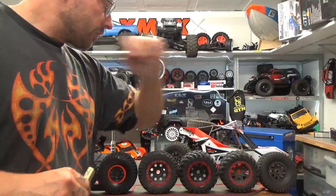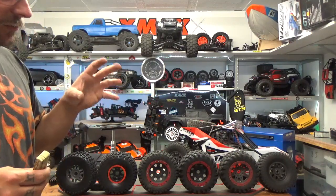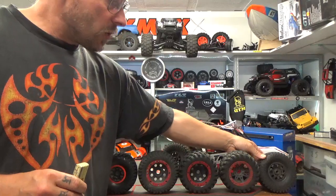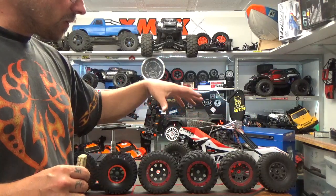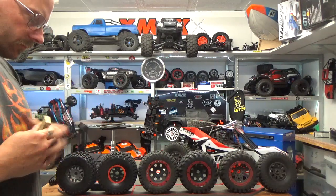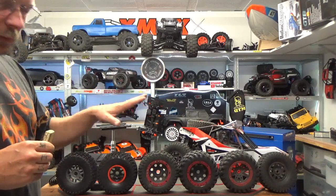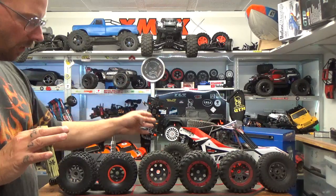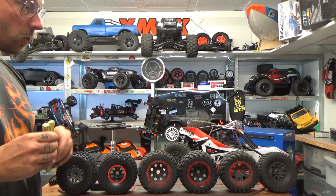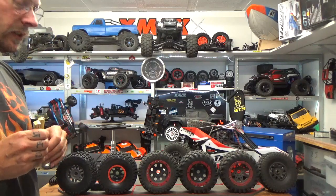The Team Magic Desert Buggy tires are also a little bit soft, but not as much as the DB8 tires. I really love them — it's really fun to drive. I don't like the design of the tires so much, but they work really well everywhere. You don't have too much grip even on grass surfaces. I've driven them only on 4S and got a little bit of ballooning, so you also need to bore a hole in the middle. 6S will also be tricky to drive; the tire might hold on but it will run a little bit hot.